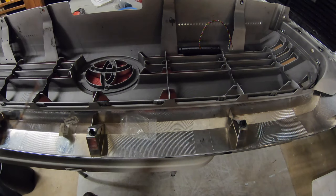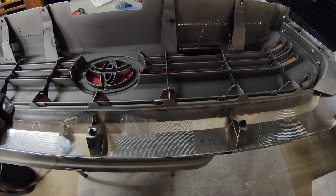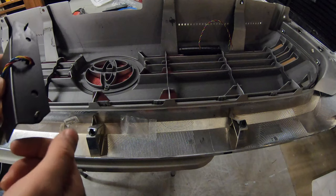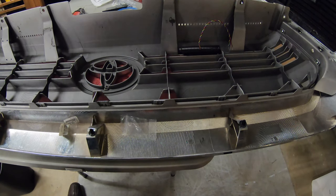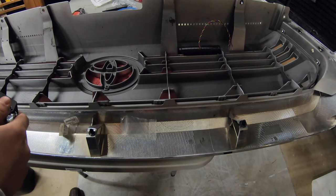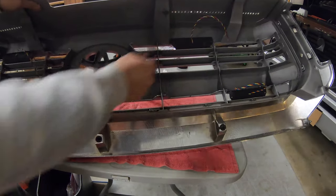On the other side, the bracket wouldn't fit correctly because the mounting location is different, so I had to cut it down and used black Rustoleum spray to cover all the cut edges so they won't rust. Something else worth mentioning: if you have a bench grinder or any type of grinder, cut off the sharp ends of the screws after installation. If you didn't know they were back there you could easily cut your hand. Grinding them off makes your work look more professional.